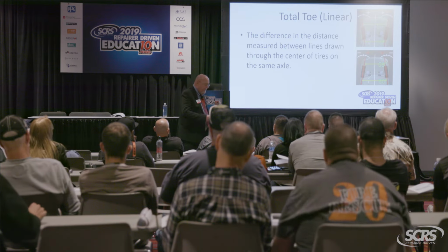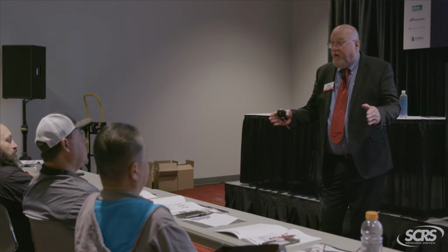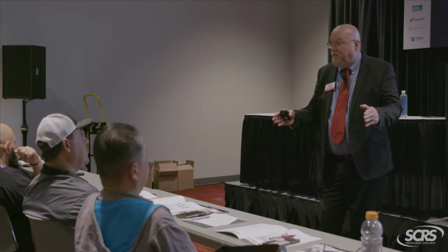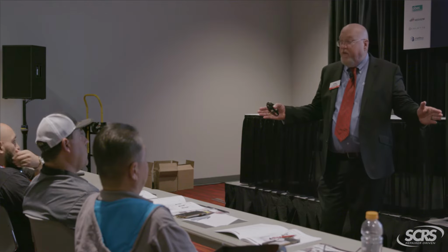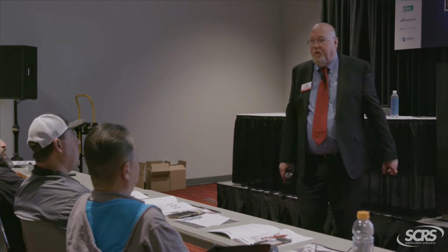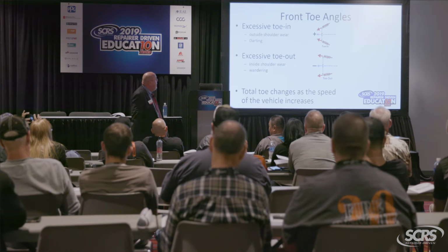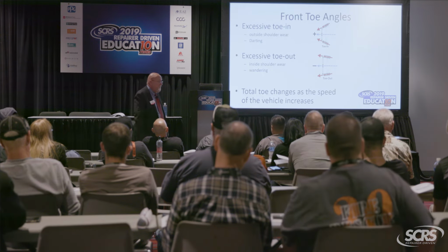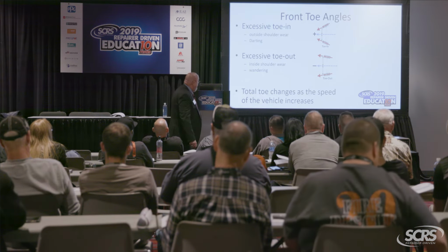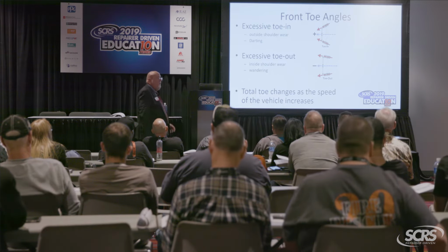So again, it's set positive. As I get out there and build the highway speed, it's going to open up and go to 0. That's the whole objective here. Now, some older front wheel drive cars used to have negative toe, but they didn't handle real good, so pretty much everybody's using positive toe or something that's close to 0. Very dynamic angle, extremely dynamic. Now, will it bring on any kind of handling problems? Yes, it will.